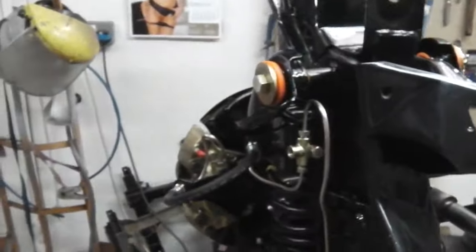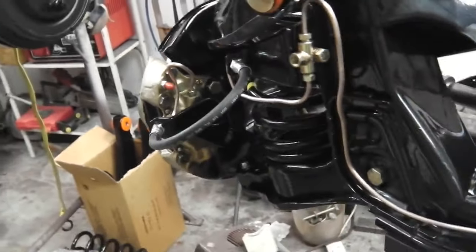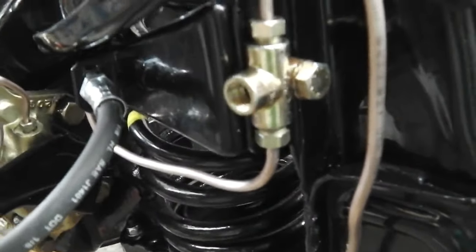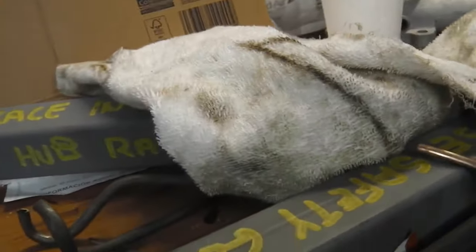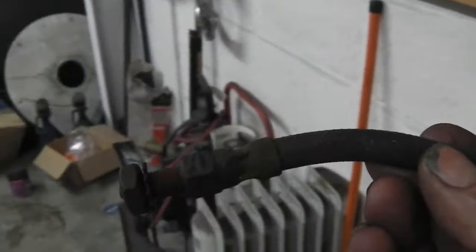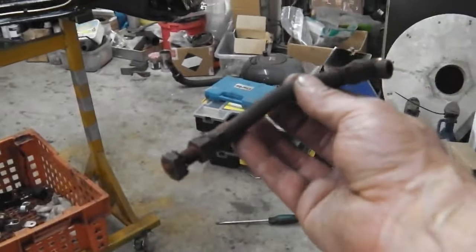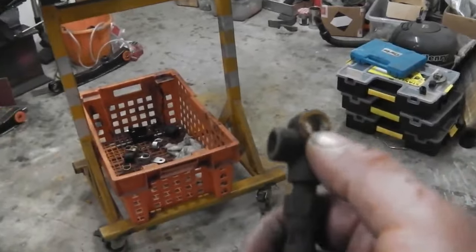That one's not a brake flexi, it's a caliper hose at the back, for the back axle. Two of those. So, yeah, you've got a flexi hose to fit there. We haven't got one, we've only got a second hand one. I'll show you what they look like in case you may be using the video for reference material, so I'm trying to always include reference material. That's the short hose to the bulkhead. Well, I say the bulkhead, it goes to the inner wing bracket, but it's a short little hose. If I hold it back in my hand, you can see, and that's another spare splitter unit.